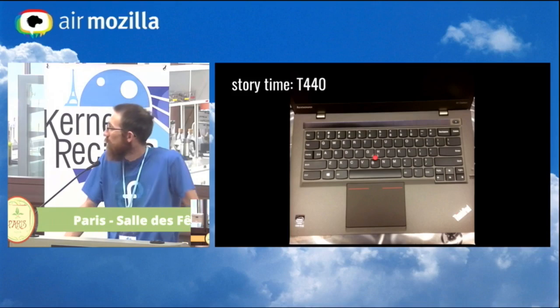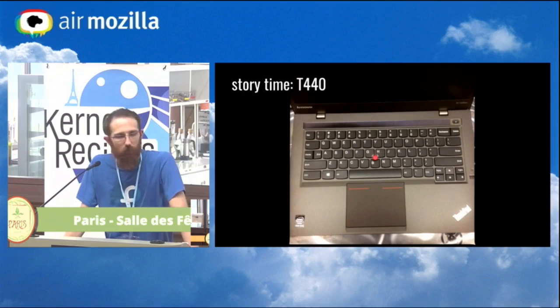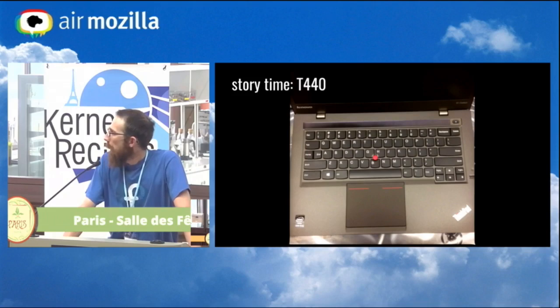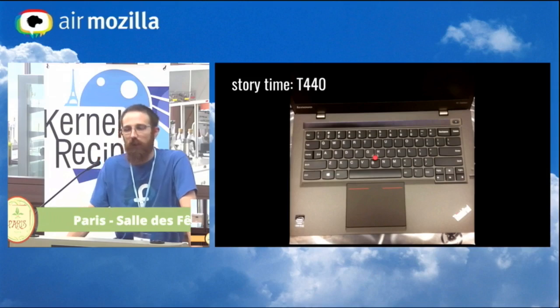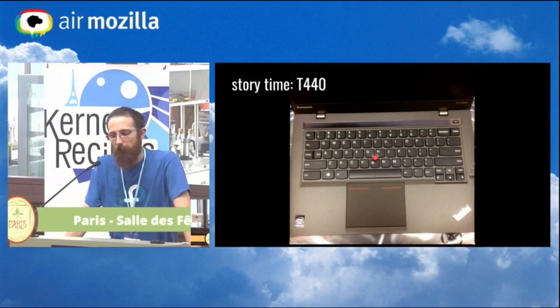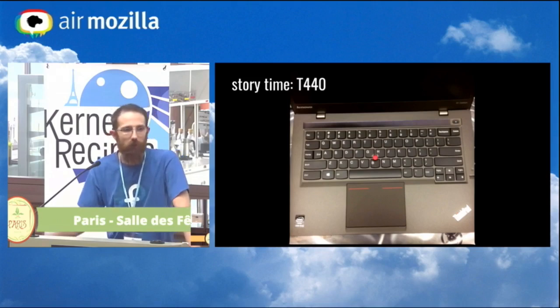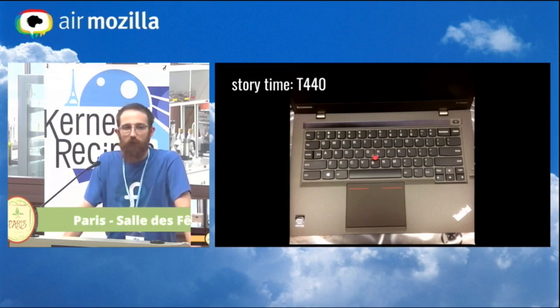So this touchpad. Under Windows, they were using SMBus, which is an operator on top of I2C. And what happens is that the SMBus interface was fine, but it was not working under Linux, of course, because the Synaptics engineers, I mean, they do care about Linux. It'd be a lie to say that they don't, but they do not have the resources to actually work fully upstream and get everything done at the right time. So it was working by chance under PS2, under Linux.